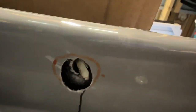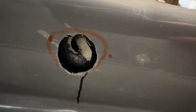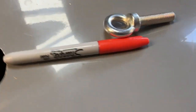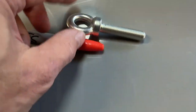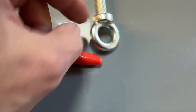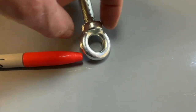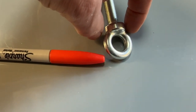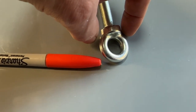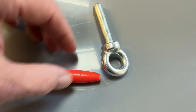I've used the little tiny pilot hole poked through from the boot to give me a rough marking, and I've been opening it up very carefully — I'm pretty dead centre. Now it's just a case of opening that up nice and neatly to fit the eye bolt. It will screw up enough to take in this section as well, so it needs to be at least that wide. With body movement I'd suggest a couple of mil all around the side, because you wouldn't want it leaning against the body and cracking any paintwork.